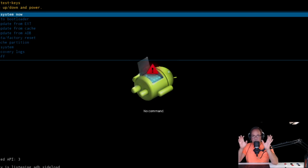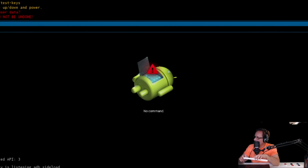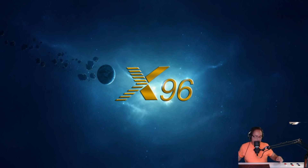All your Kodi stuff — everything will be gone. But don't worry about it, there are plenty of videos on my channel that will help you get back on track. This will get the box back to the first day you received it. The box is going to look the same way as that day. Now we're going to go down into the menu and do wipe data and factory reset. We hit it, moving the arrows down, and we click on it — yes, I want to wipe everything out. It's going to format the drive as you can see. Then it gives you an arrow. At that point we take the power out and plug it back again.